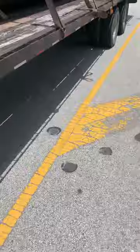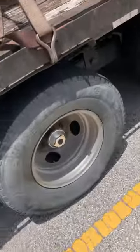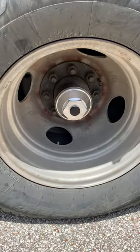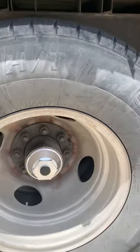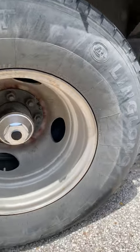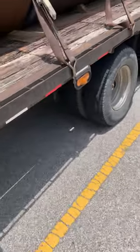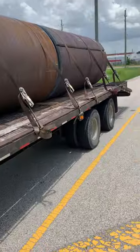I'm getting much lower temperatures with the double zero grease, which is right along the lines of an oil bath. Pretty happy with that. Got bad seals, they're leaking with your Hub Oil. Looks to me like that double zero grease is doing its job, and it's doing a damn good job. It's a high-speed spindle grease, and that's what these axles are — just a high-speed spindle on these Dexter axles. That's with a 20,000-pound load.